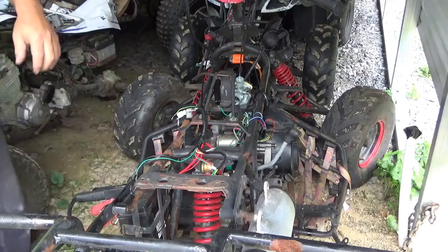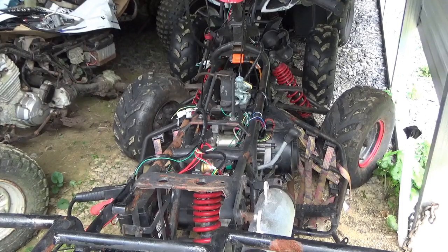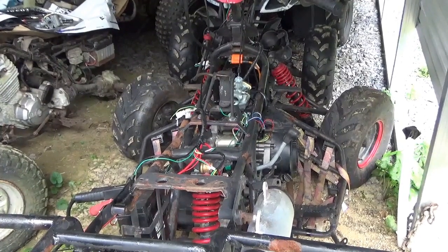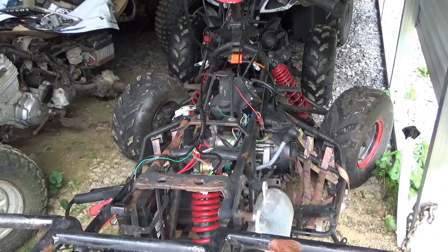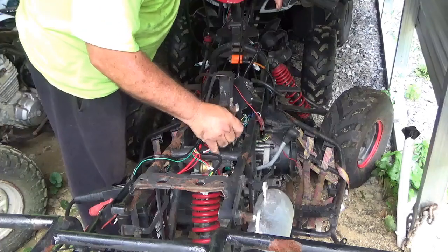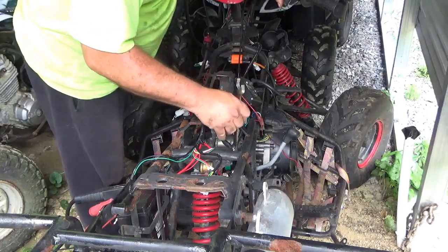Maybe it's a little better, but it still basically has that problem. I have a portable CDI made with the GY6 CDI box, let me try that. Okay, I have it set up with the proper GY6 CDI so the ignition curve should be better and it should be happier. I also turned up the idle a little bit - maybe too much, we'll see.